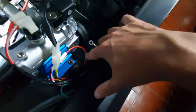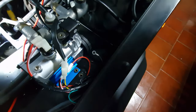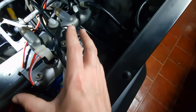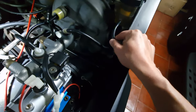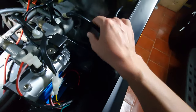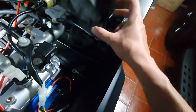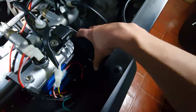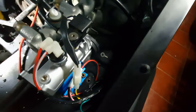See, I unscrewed here the air pump, the air compressor for the rear traction blocking. I'm going to push it more forward, and this is going to come more here because it's only one tube that has to be a bit longer, and this is a rubber one, so it's easy. This is a rubber, which might be like silicone or that, so I can just use this length to push it towards here. And I'm going to put a little stainless steel plate on the bottom, where I can accumulate all the oil that starts spilling out, you see?